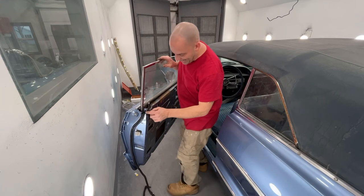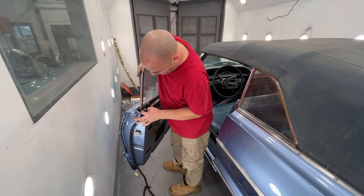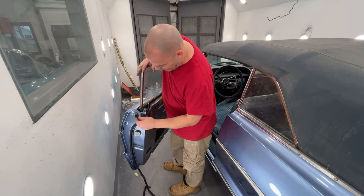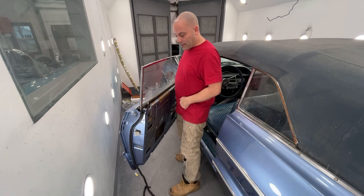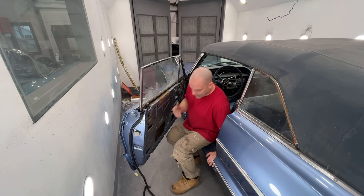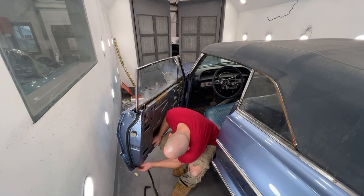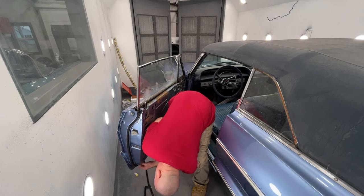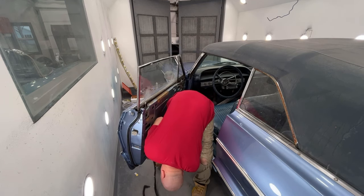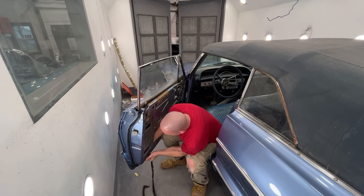And then they give you plastic pegs that go in this top one here. So you gotta lift up on this and put the plastic one in. But like I said, I like the glue from here to the peg, and that helps it from wanting to come out in the future, because they do tend to want to pop out if you don't put some glue on them. I've never had a problem with the rest of the rubber coming loose on the door, just on the top edges on front and back.